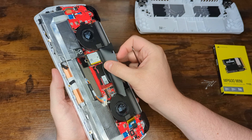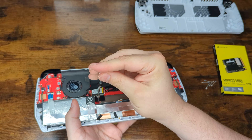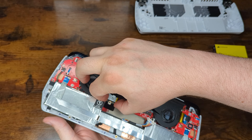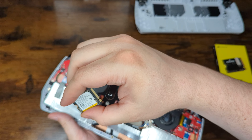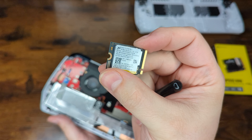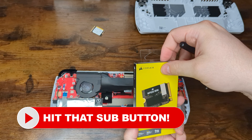Now go ahead and remove the old SSD with your screwdriver. Make sure you don't lose the little tiny screw. With the screw removed, you should be able to easily lift out the old M.2 SSD, gently rocking it back and forth to slide it out of the connector. It is now removed — you could use it in something else if desired, or put it in an external storage shell to use with the Ally.